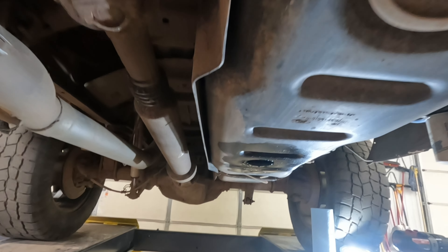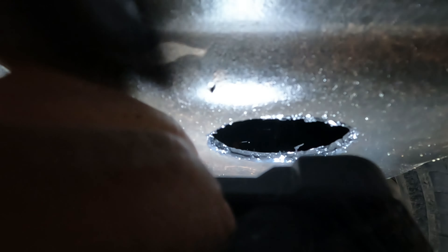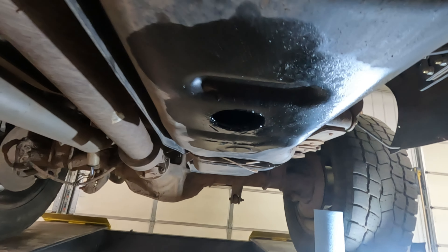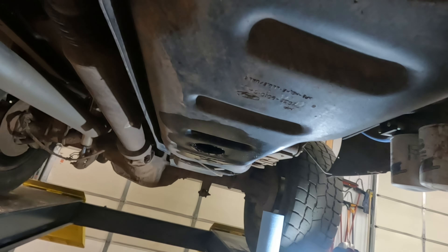If you look, it's almost dead square in the center of the tank. The best way to reference it is right here — this is where your factory pickup tube is at. I don't put it right here because that'll hurt your factory pickup tube. What I do is put it right in front of it at the next flat spot. There's a ridge right here, and then you've got this curve right here — put it right in the middle of that. It seals perfectly, never has a problem. We've got 20,000 miles on King Twins like that.